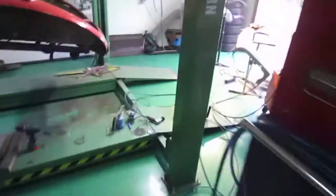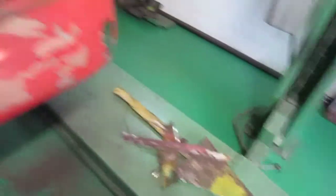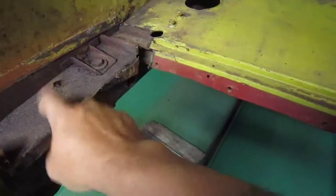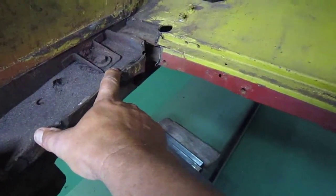And on the inside, so we can repair it. Amir is doing this boot floor here — he's cut some of the pieces out already. This is the opposite side. There's a cover over here but you can see underneath it's in pretty bad shape, so we'll have to replace this piece as well.